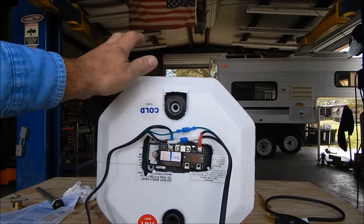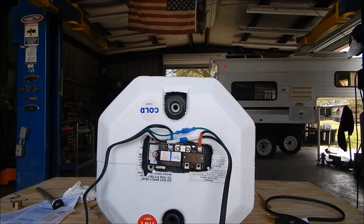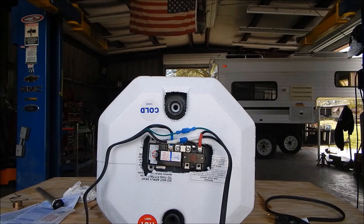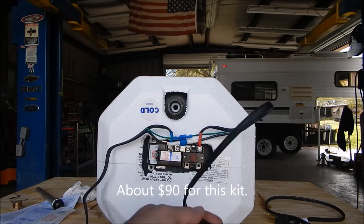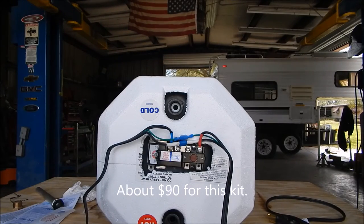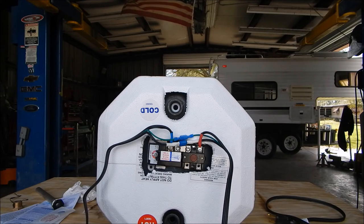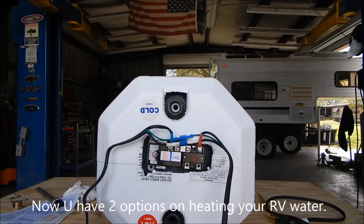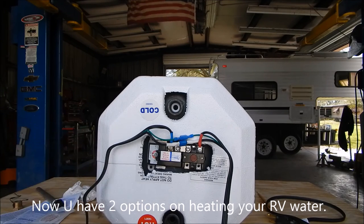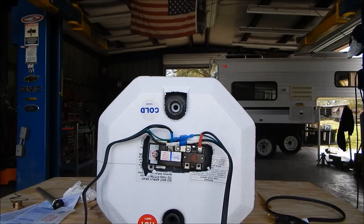I need to do some repair work on the camper, which is why I demonstrated this install out here on the floor — easier to show. That's the conversion over to AC from LP gas. If you want a lot of hot water, you can run the AC element and the propane at the same time. I'm going to run the cord to the outside box where the inverter plugs in, and also run it up under the sink for another plug when on shore power. So there you have it — the Hot Rod electric conversion for the propane tank. The whole deal including filming took about an hour and was pretty straightforward. You need to access the back side of your water heater for the thermostat — hopefully you've got room to do that. That's the conversion, thanks for watching.